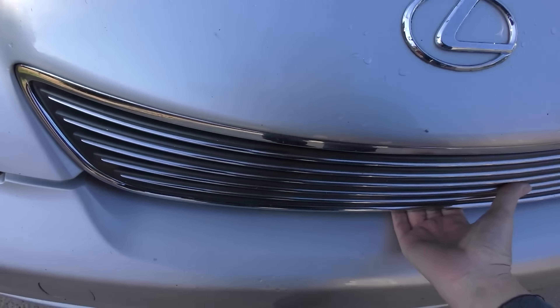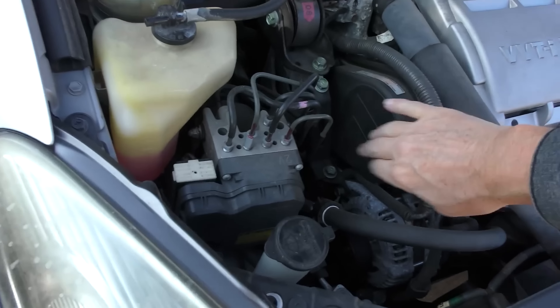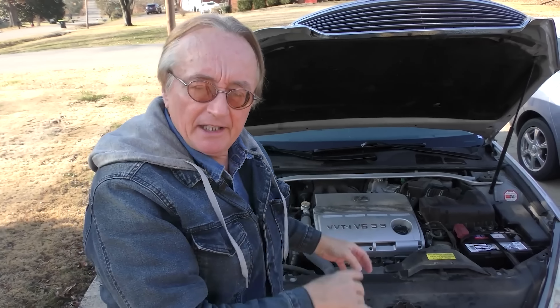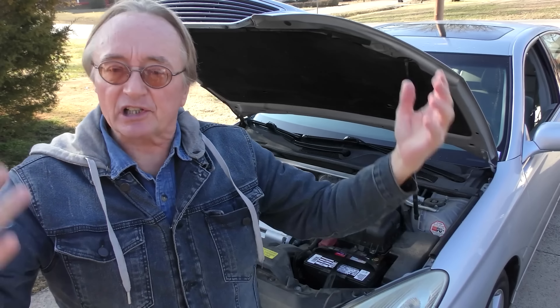Pop open the hood — smooth running engine. Just realized this particular engine has one downfall: it is an ES330, so it has a rubber timing belt, unlike just about every Toyota that's ever been made. But you can see this one has been changed — it was changed at 63,000 miles, not too long ago, and it's at 75,000 now. So he doesn't have to worry about it. Interestingly, some other mechanic gave him a list of things he needed to do, including the timing belt and water pump — but this was just changed recently, so that guy was trying to rip him off. Always check things before you pay money for anything. It was done about 13,000 miles ago and they go up to usually 100,000.